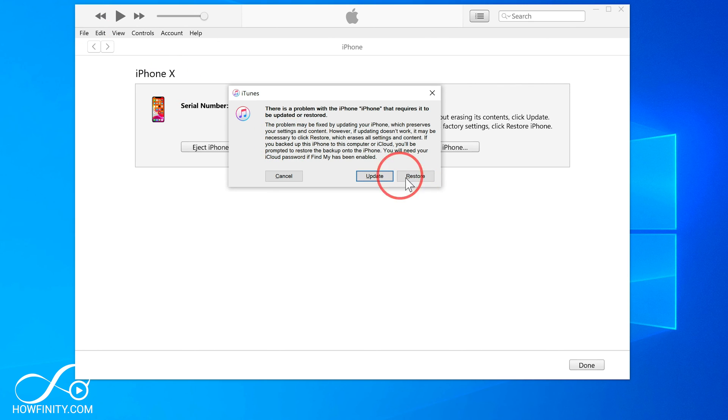If you're using a PC — for example Windows 10 — or if you're using an older operating system on a Mac, you'll need to have iTunes installed on that computer. iTunes will open up and you'll get the same exact window where you have to press Restore. Again, you will lose everything on that phone and you'll need to use iCloud or iTunes, depending on how you backed up your iPhone, to restore everything back after the reset.